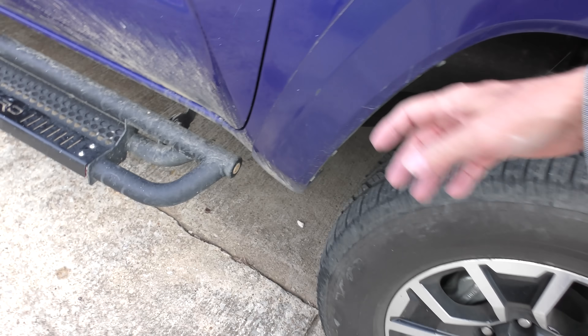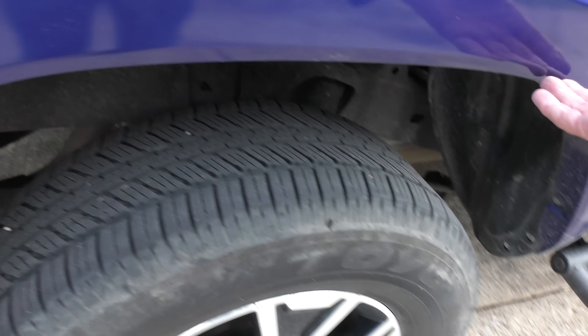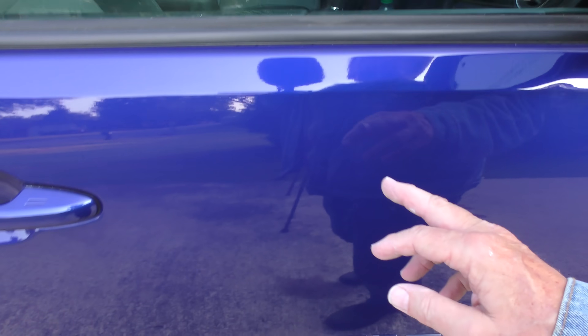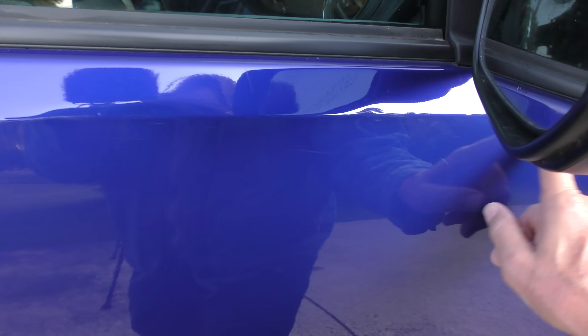That's one of the reasons these are all plastic inserts on the fender liners in the front and back — rocks aren't going to dent plastic, it'll bounce off, and if it breaks you can replace the whole thing. But this is steel, it's going to dent when a big tree branch hits it. You start polishing those dents and you're going to notice — you can see this area is straight, but here's the dent and it stands out, it's too easy to see. You can get the scratches out, but it's going to take a real pro paintless dent removal guy to do that.